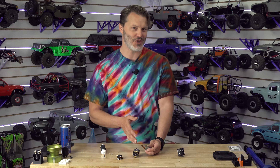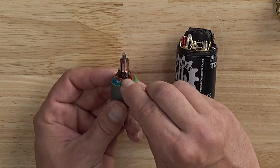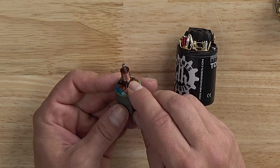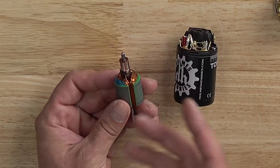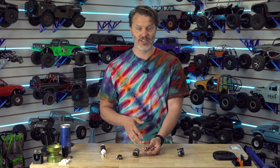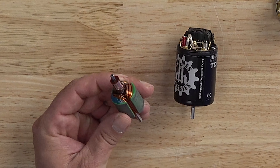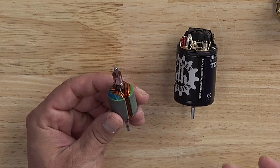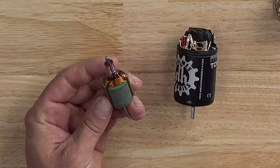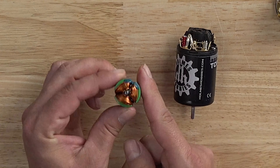Epoxy balancing is a little heavier, so if you're looking for racing fast acceleration, it may not be exactly what you need — but these are crawling motors, not racing motors. We braze the commutator connection. You can see the copper wire coming in — that's actually braze, not solder. Braze has a much higher melting temperature, about 1100°F versus most solder which is in the 600–700°F range. So if you're really pushing these hard, you're not going to sling solder off and have your motor ruined.